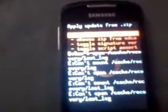Now go to the fifth option, which is 'Install zip from SD card'. Then select 'Choose zip from SD card'. Note that touch is disabled here, so you have to scroll up and down with the volume up and volume down buttons. Scroll down and you can see the file called cm9-20121211-unofficial. Click on that and select yes to install it.